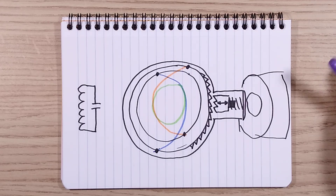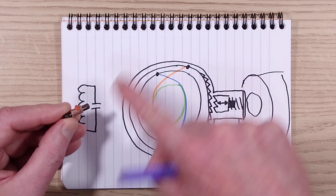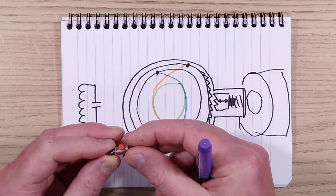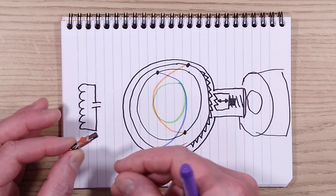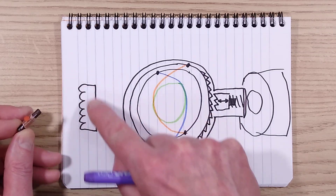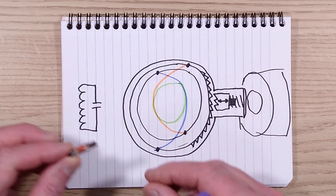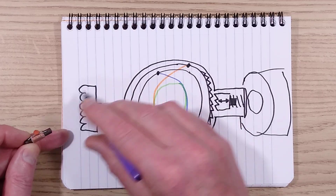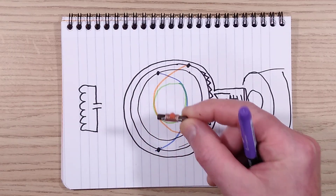Very cheap, very simple. That's also very similar to the way that the paper stickers work — with a coil and two pads in very close vicinity, acting like an inductor and capacitor. To deactivate those ones, they pulse it with a high current pulse, which induces enough voltage to break down the capacitor and make it fail short circuit. When that happens, it effectively just becomes a link through, bypassing the circuit from operating when you remove the deactivated tag.